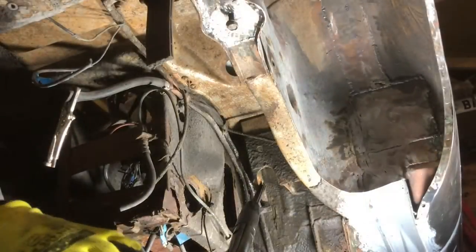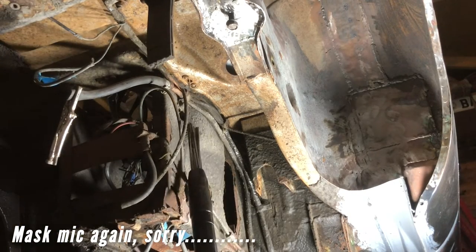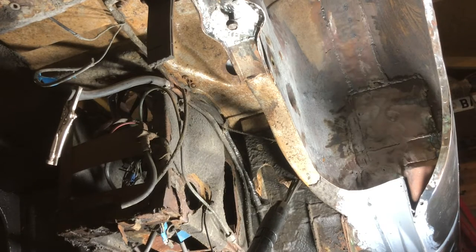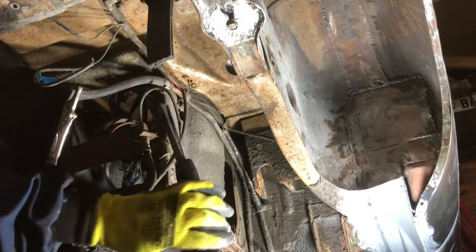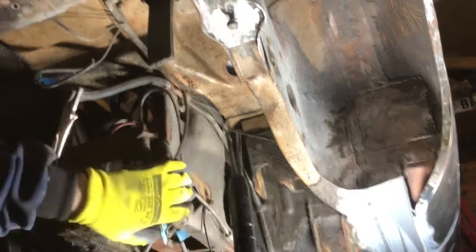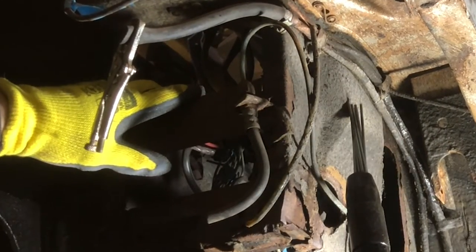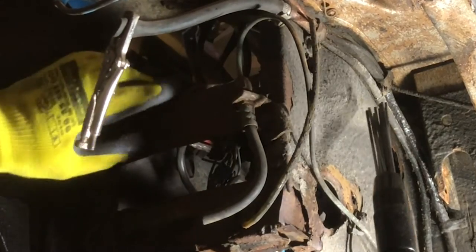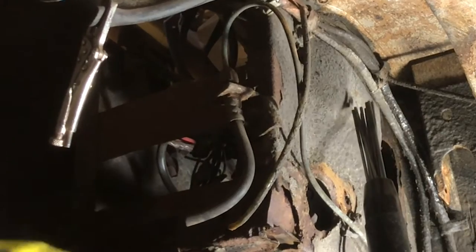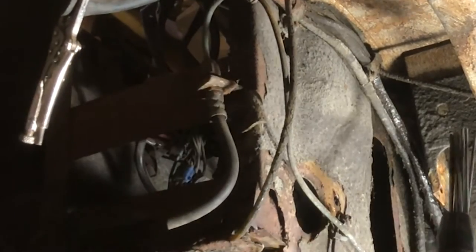In a minute, what I'm going to do is get rid of all these extraneous fuel lines and hydraulic lines and things. I just wanted to get into this today, because it's a while since I've been under this and done an awful lot. So I just wanted to get some of this done today. But one of the things we're going to need to do, particularly before we move this battery tray, is to take a few more photographs, note exactly where everything is mounted, all these little clips and things, because when we rebuild a new battery tray or graft new sides and bottom or whatever we decide to do, we're going to need to reproduce these mounting points that you see.